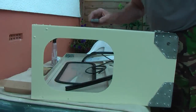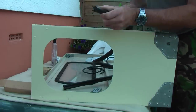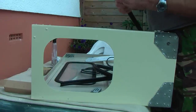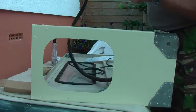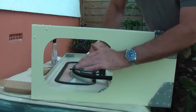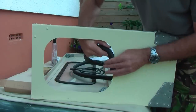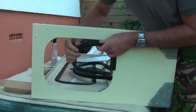So I'll just insert that now. Ensure that you've got a nice straight cut, a clean 90-degree cut on your rubber. I use a very sharp knife for this. For appearance sake, I'm putting the locking strip on the inside so that I have a nice clean line on the outside. So I start halfway along the bottom there and I feed it around all the way around.